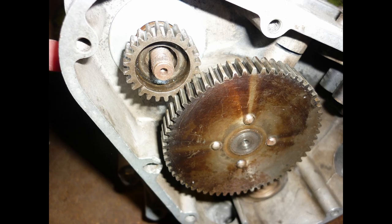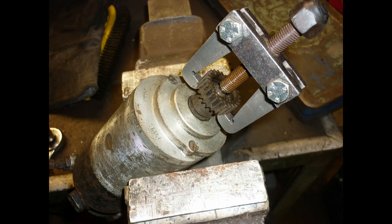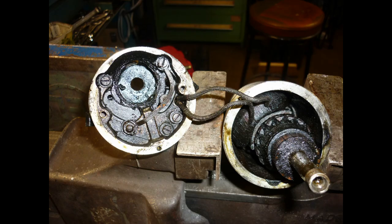Oops, for some reason the dynamo pinion that I have is too big. Research shows that earlier Red Panthers used a Miller dynamo with contact breaker points incorporated, which was the one which previous owner Steve had found in his search for missing parts. Main drawback of the system was that it had to run at half engine speed.